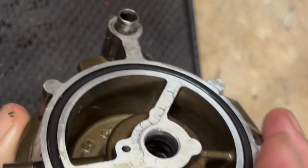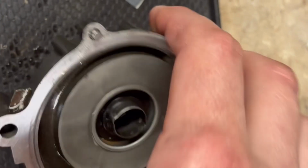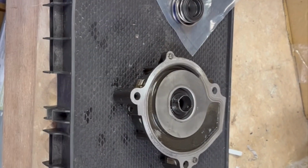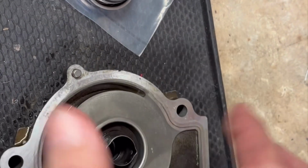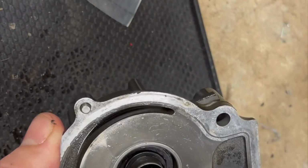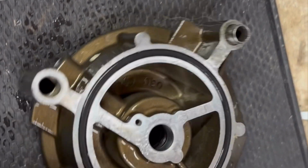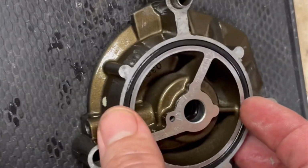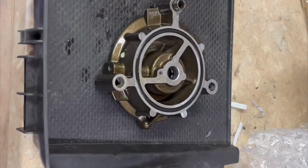It's designed for it. Also, we were getting oil through into the coolant and it was mixing, so it's going to be a bit terminal if that had been continued to ride like that. So I'm glad we've got to the end of it. I've got all the parts here to go into the oil seal. It looks like it's a bit of a git to pick that out. But what I don't have, the book says that this O-ring must be replaced, and it's not available in that kit, so I'm going to have to see how I can source one of those and get it fitted.